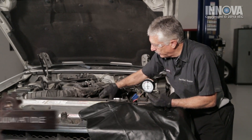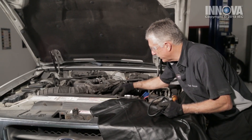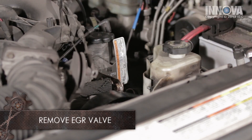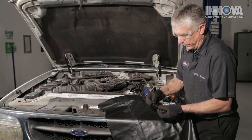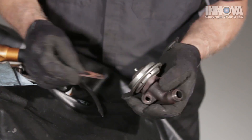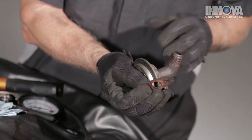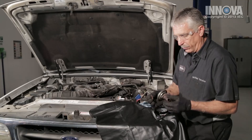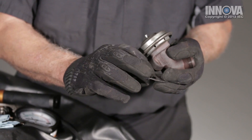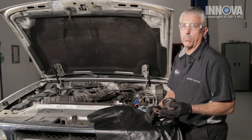Let's suspect that we may have either carbon deposits in the valve itself or just a stuck valve. For that part of the diagnostics, we're going to need to remove the EGR valve and physically check it. We also want to check and see if our gasket is broken — we could have a big leak there. This gasket is somewhat cracked. You can see the carbon that's up in the valve. The carbon deposits will cause the valve to stay off its seat and that will give us our random misfire at idle and create a drivability concern. We also want to make sure this vacuum is not leaking around this gasket. Since this does go to manifold vacuum, that's an important gasket to have.